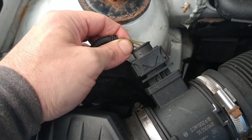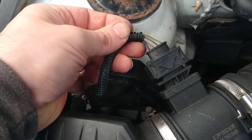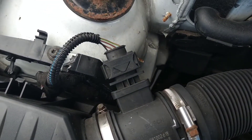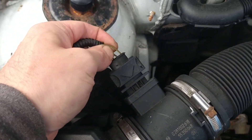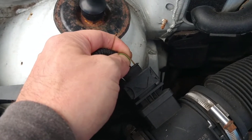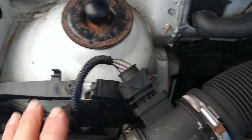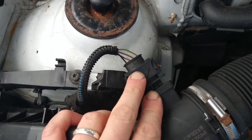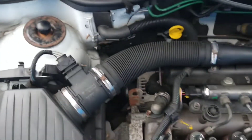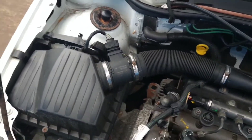So I checked the wires and I do have power, ground, air temperature, and I have the airflow on the very last one at this end. I checked that in a pretty similar way to checking the pressure sensor. The difference is instead of having an analog signal, it's a frequency. The frequency I'm getting with the ignition on, if I remember right, was 1.8 kHz, which I think is about right for this car. Now it's showing when I crank it, it's somewhere between 3 and up to 10 grams per second whilst cranking, and drops back to zero. It's only done that since I've disconnected and plugged it back in. I'm using a Foxwell scan tool instead of the Ethos — I think it's just refreshing quicker. So I've done that quick test and it still didn't start.